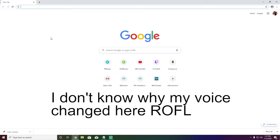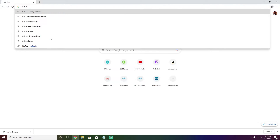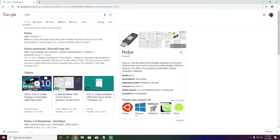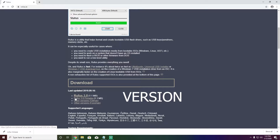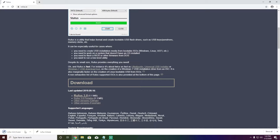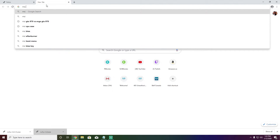Before you put your BIOS onto your USB, you should make your USB a bootable drive. First step is go to Rufus and download it. In my case I just downloaded it earlier. Now plug in your USB, and download the latest BIOS for your motherboard. Since I'm using an MSI motherboard, I'm gonna go to MSI.com.